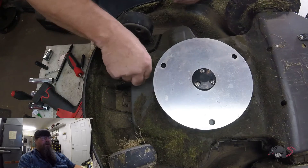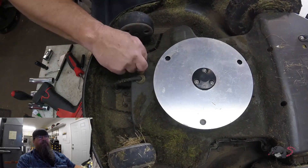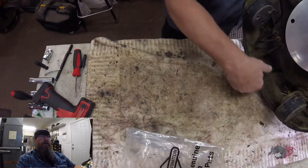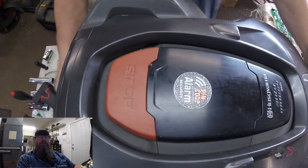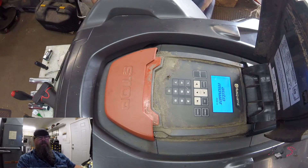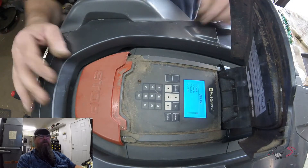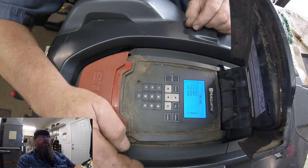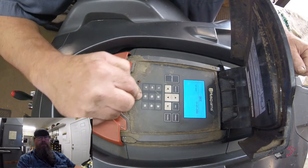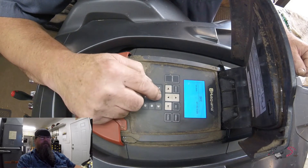At the end of this video you're going to see the machine boot up, and then I'll hook it up to my auto check software and check for updates. But the last shot you'll see is how it doesn't boot up — and that's what you get when you put in a brand new board. A dealer has to handle that because there's no serial number associated with the board yet. In fact, the board doesn't even know what model machine it was just put into. So you can't just buy a new board, bolt it in, and expect to be on your way — it's a dealer-only task.